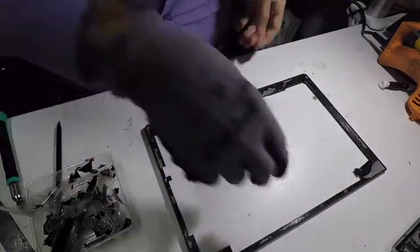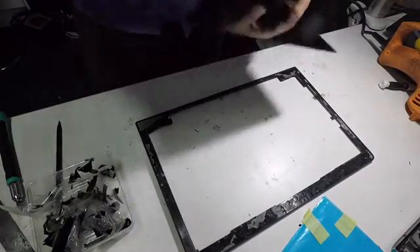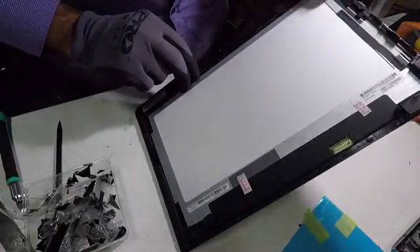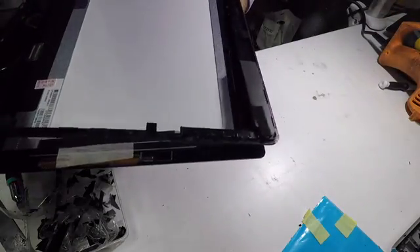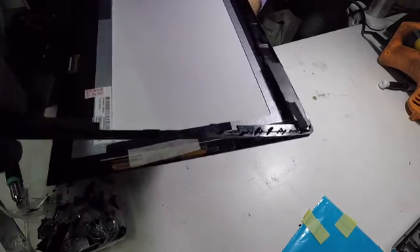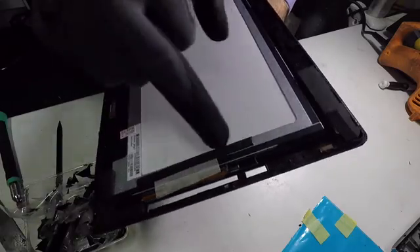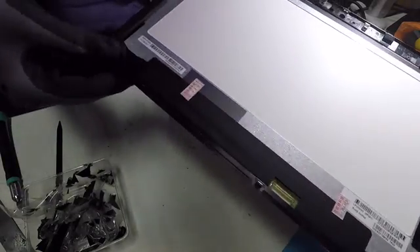What I would like to do is inspect how this new screen will go in before actually doing a full attempt. Have a feel, have an idea how everything is going to fit. Most importantly, the IC chip on the side of the LCD for the digitizer has a special way of going in — that little part actually goes in at an angle first, inwards, and then you push it in and it locks into the screen. It's a bit tricky, so have a good look. You can see those two little notches — they actually go under the IC chip, and there is a ribbon cable which must be lifted up.